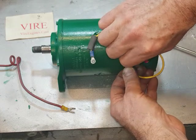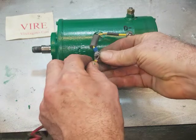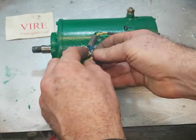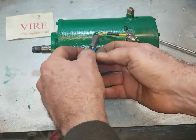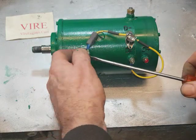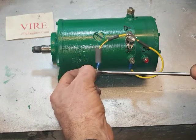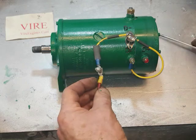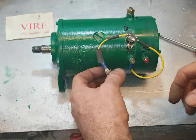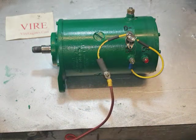You need your wire going through here in series. So instead of the original wire going on there, you use my wire - and you can see there's a nut and bolt end to this, so that you can reconnect your original forked end or DF cable. Do that up nice and tight. When that's tight enough, pull the rubber boot over it so that you can't accidentally earth this cable - if you did, it forces the Dynastart to charge fully.